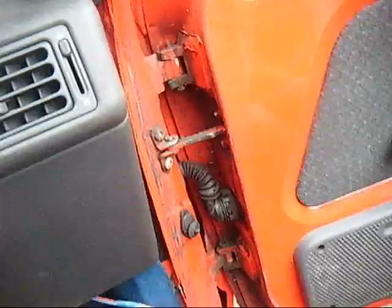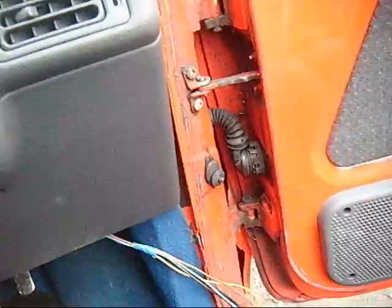A little bit jiggly. You don't just yank it all the way through, you have to guide it in at the top and just slowly yank it down bit by bit from the bottom. It makes sure it all comes down together and none of your electrical tape comes off, which means you have wires come down and then there's some still stuck behind the dash. Which means you have to do it again. So just take your time, be gentle, and it'll all come out just fine.